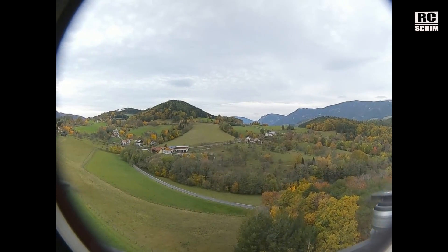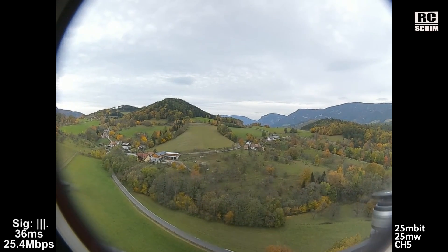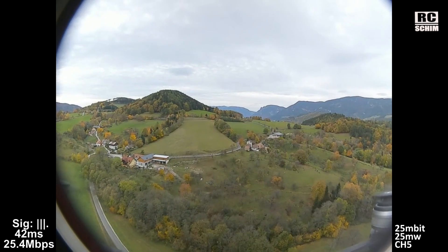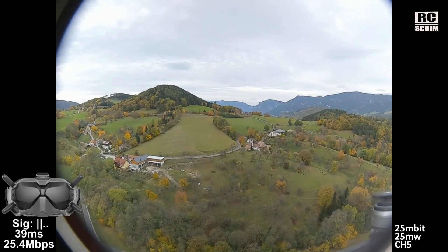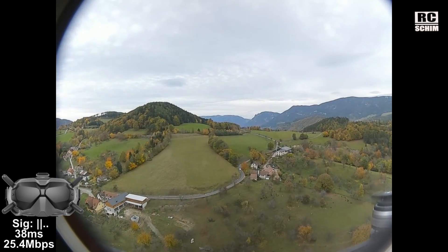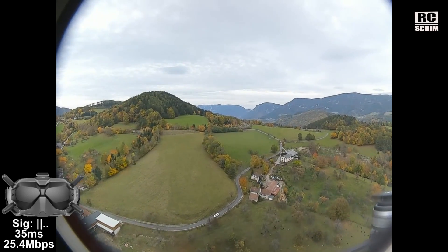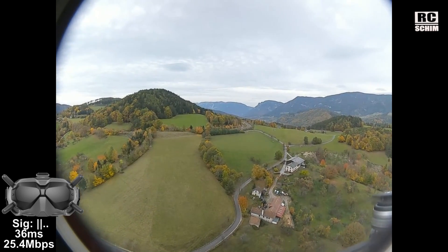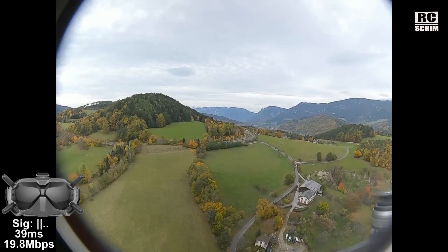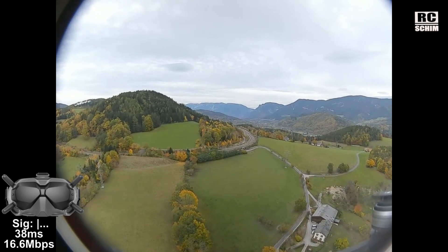Okay guys, 25 milliwatts — this way we see the degradation signal the fastest. First flight with the DJI stock on the goggles and DJI stock on the copter. This time I try to fly higher to avoid the Fresnel zone or something blocking my sight. I also opted not to have the waypoint this time because I just don't like the way the GPS flies.